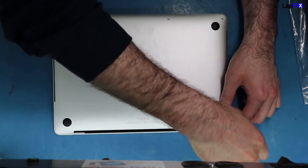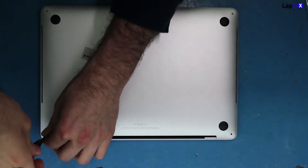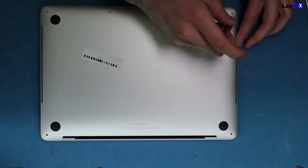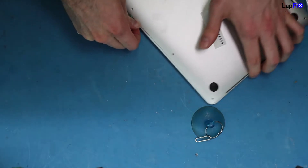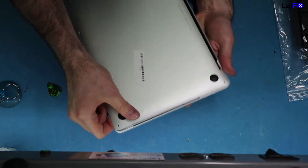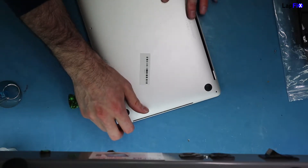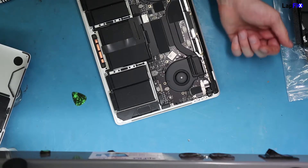Let's open up the back. Just take off a bunch of screws. Then take a suction cup and open it a little bit. What you want to do is hear the sides go — they like to go pop. Then that should come up. Pull on this side and it should come up. It can be a little bit difficult. There's a little latch on each side, even on the left and back side. Be careful — there are little hooks on there.